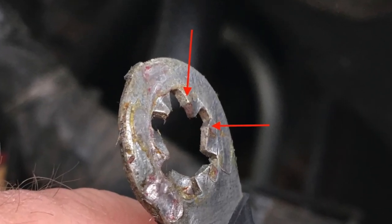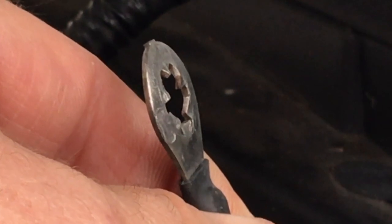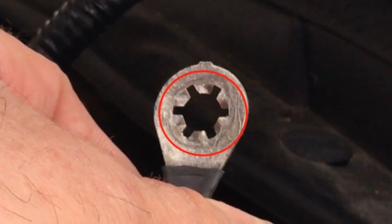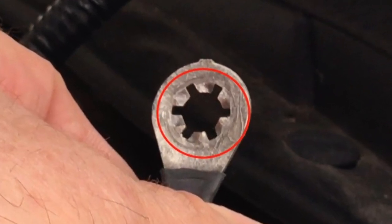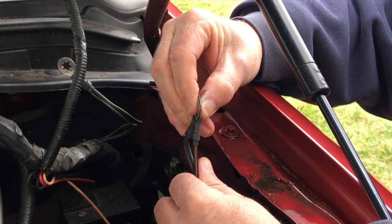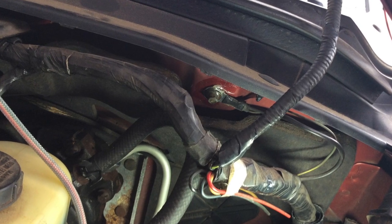This unbolted terminal shows the teeth have returned to a twisted state, so the metal has some spring to it. Looking closer at the terminals: one side has the teeth punched proud of the rest of the terminal surface, but the side facing the washer of the fastener is flat with the teeth punched through — providing the best contact area toward the washer. These terminals are larger than any store-bought terminal, so they have a larger mass, just like a larger wire, and would flow more current. The teeth nest together very well in a stack, but Ford uses no more than two terminals stacked together, otherwise two wires are entered into one terminal. On early models, heat shrink was used to protect the crimps from environmental exposure.